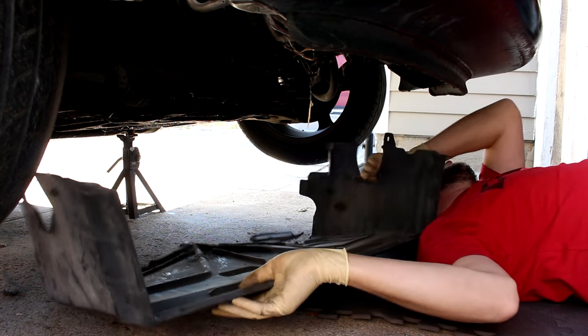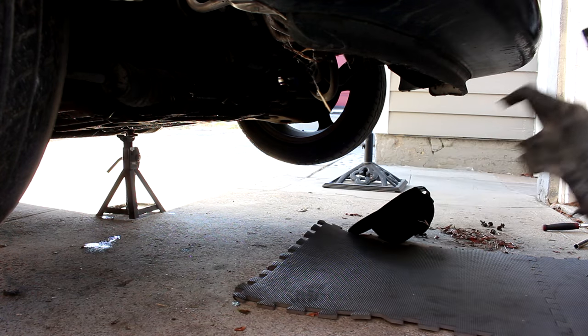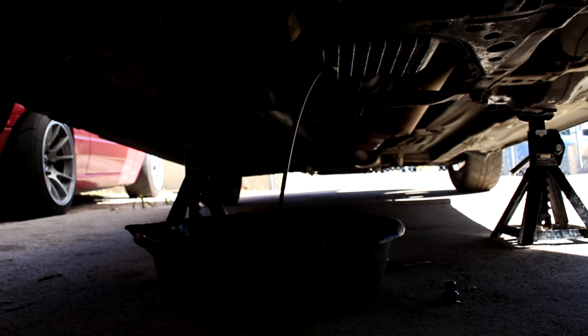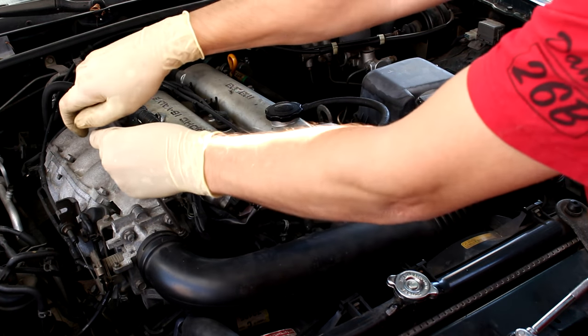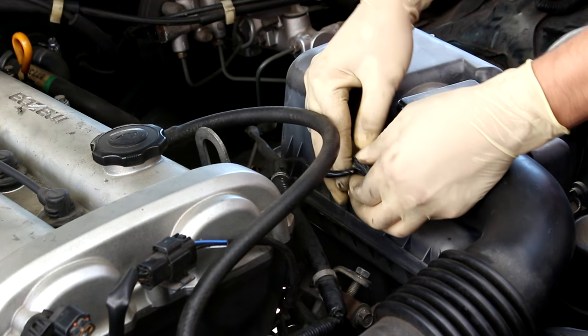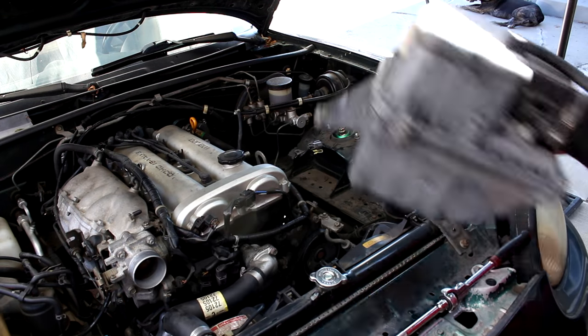If you're tackling all or most of the jobs I'm doing in this video, your best friend is to get as much stuff out of the way as possible. Drop that splash guard with a couple 10mm bolts, then drain the oil out of the pan and drain the coolant from the radiator. Remove that radiator cap too, and it will just flow out. Make sure you have a large enough receptacle to catch everything. While everything is draining, don't forget to disconnect that negative battery cable. Then get that intake out of the way with a couple of Phillips head screws, unplug your intake air temperature sensor, your mass airflow sensor — or AFM if you have a 1.6 — your breather tube, and the whole thing will pull out as one piece.